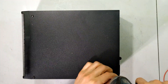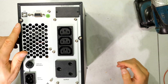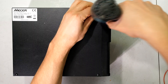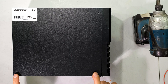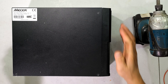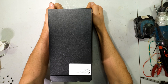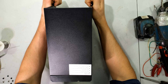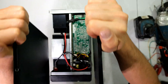Go around and make sure you've loosened each screw. There are two silver ones on the back. Once you've removed the three screws on each side plus the two at the back, put the UPS upright. Take your fingers and pull the cover upwards, keeping your fingers away from any of the circuits — pull it upwards and open.